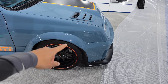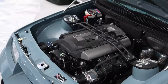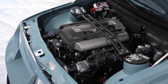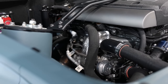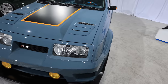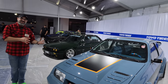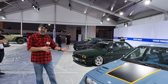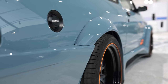So you guys created this kit? It all started with how do we get the Ford EcoBoost motor into the car. We did a scan of the engine bay to figure out how we'd fit it. Because it's direct injected, we had to push the HVAC and the firewall three inches back away from the high pressure fuel pump. We changed the oil pan to a Ranger oil pan and got the engine in the car — but then the engine stuck up above the fender, which led into the hood. The hood was more aggressive than the rest of the car, so we scanned the whole car and created molds to build it four inches wider than stock, with flares making up the difference.